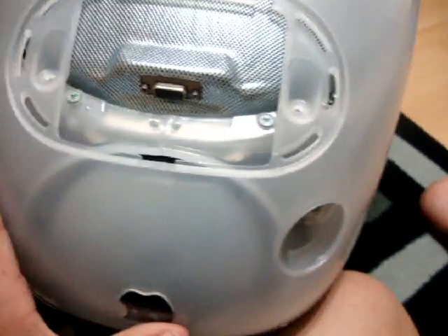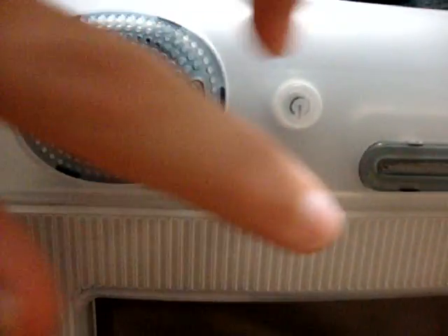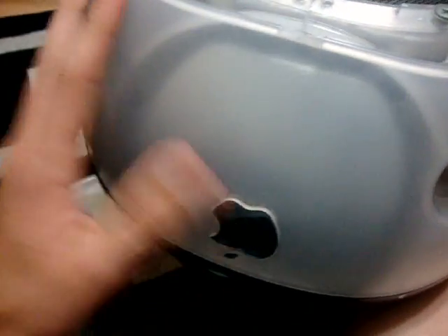I have opened this case before, but if you haven't, there's usually glue inside that pretty much seals it. There are also three tabs in the front — one here, one in the middle, and one over here. When you open it, you're going to hear a little cracking sound. I suggest you open it from the back — the Apple logo side — it's going to lift up and you'll hear the snaps. Don't worry, it is not cracking.